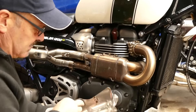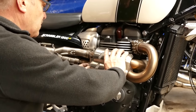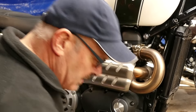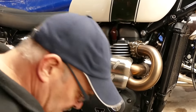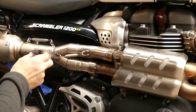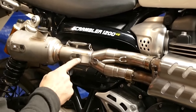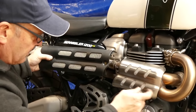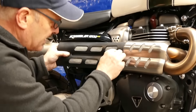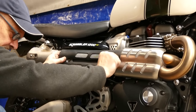Now you see you've got little rubbers on here that these hook onto — make sure it's hooked onto all three of them. And you have holes lined up here at the front. I'm going to reuse the original screw here. But at the rear you fit the M6 lug nut to the sliding mount here. This is a little bit fiddly to get in because it needs to hook underneath first, then you need to line your holes up.